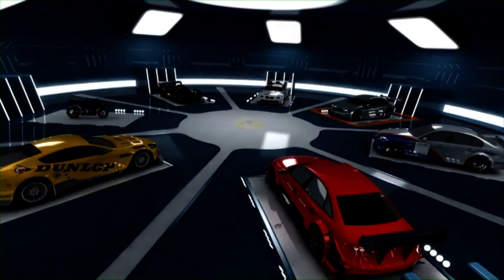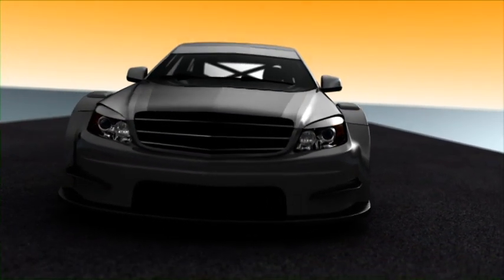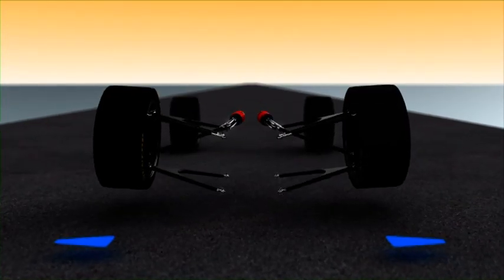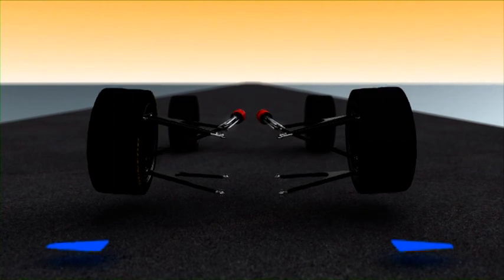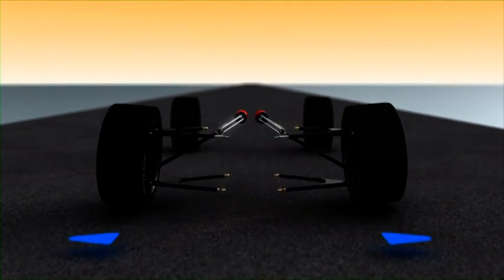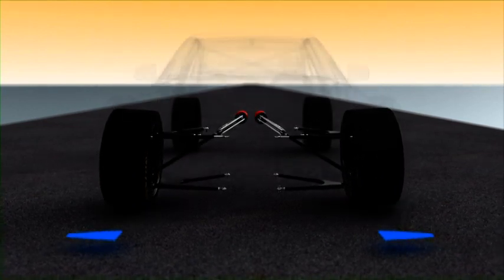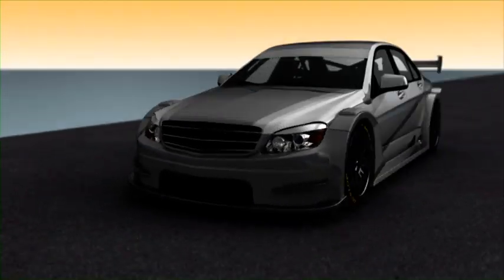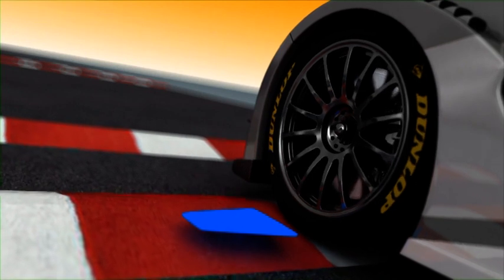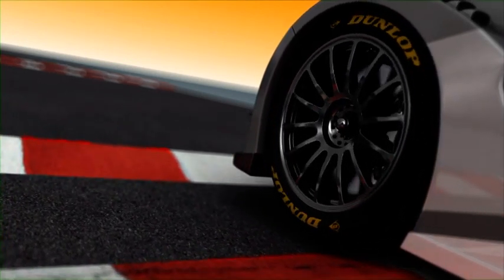The key is to utilize or spread the load as well as possible — for example, as in touring cars. Here, they set a negative wheel camber. That means greater lateral guided force around corners. The pressure gets spread more evenly onto the tire's contact area. The aim: a high level of grip and steering control, for example through faster ground contact after riding the curb.